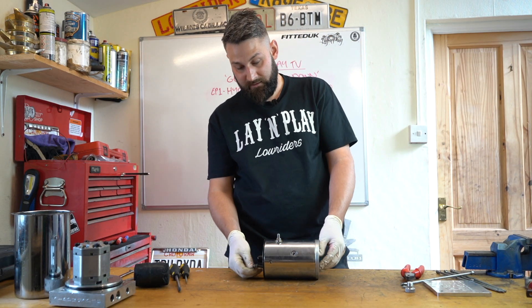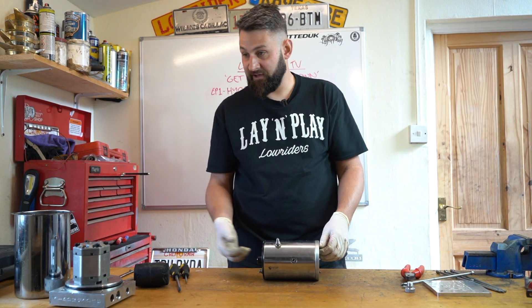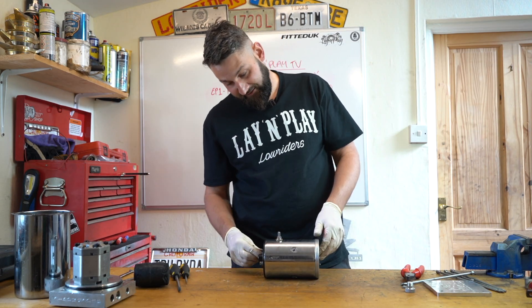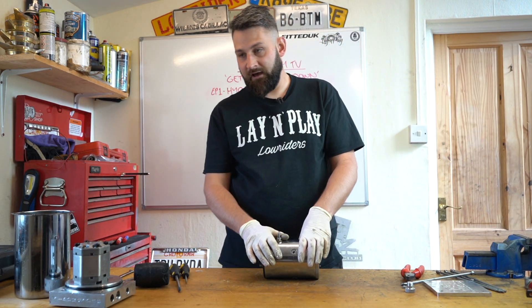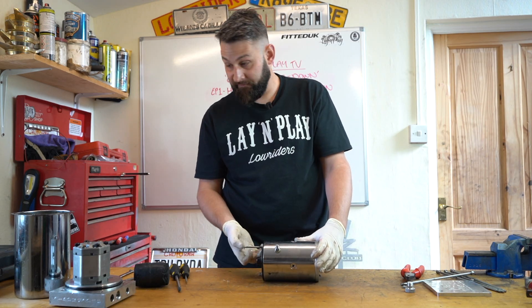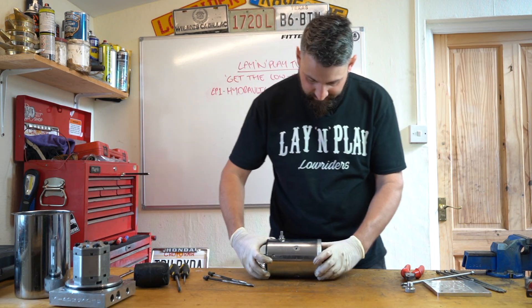The motor - I think they're designed to be just a 12-volt motor, the same as what you get on hydraulic pumps on transit tipper wagons and stuff, only these aren't as agricultural. These have been designed to take a little bit more kick. Some of these you'll find are running up to 96 volts - these have probably been in the Honda doing about 48. Let's strip this one down.